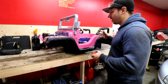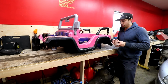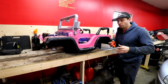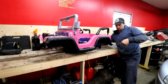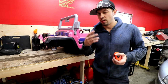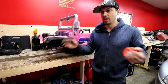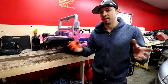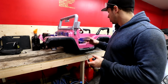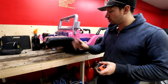And then I had to find out what length of axle I want in the back so I can figure out kind of what I need to order. So from the fender to fender is 26 inches. When I go to buy it, I'm gonna have to factor in the offset of the wheels, the length of the hubs and how far they slip on, and how wide the tires are. But it's 26 to both sides.